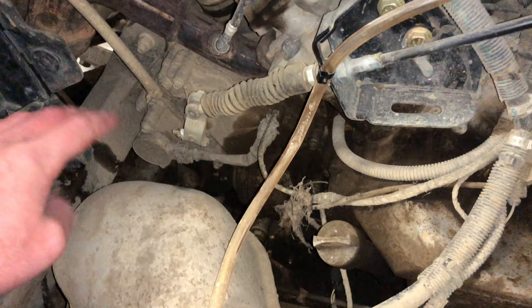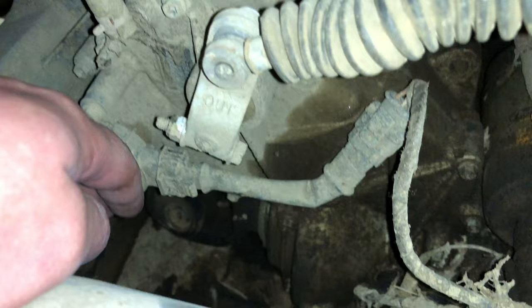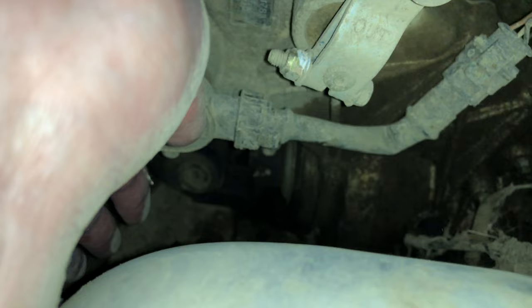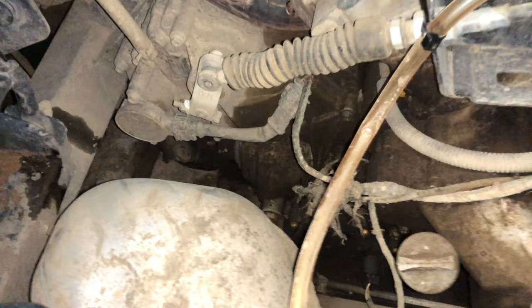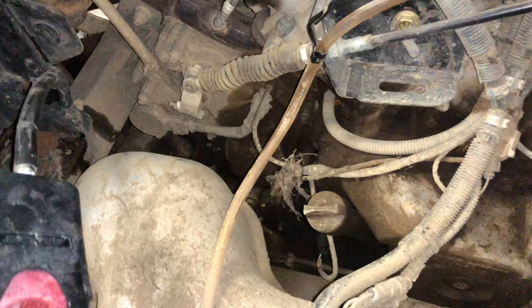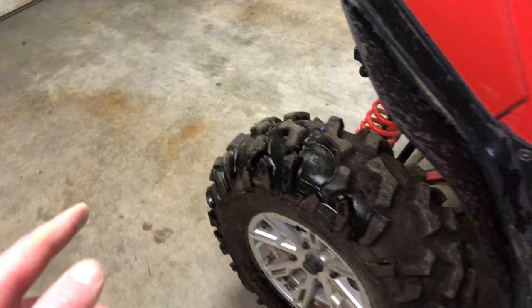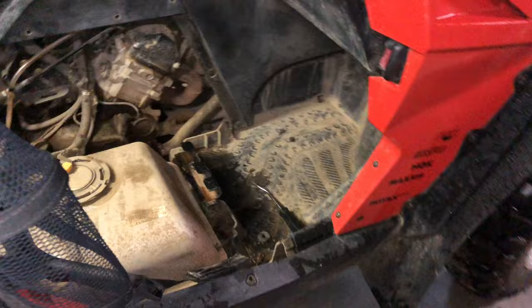Now that I've got all these plastics out of here, you can kind of see what we're trying to get at. Here's basically your motor, then you've got your transmission and everything, and down there you can see the driveshaft. You might be able to get to it without taking the plastic that covers your gas tank, but it would be really hard to reach in there and angle your hand back. You might be able to see that bolt right there that basically holds the driveshaft into the back of your transmission — that's what we're going for. I believe it's a 13mm bolt and it's a pretty short one, so it comes out fairly easy. Hopefully I can use a ratcheting wrench. That'll make it go a lot easier.